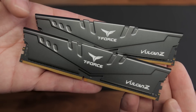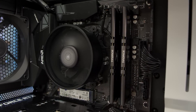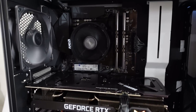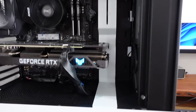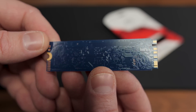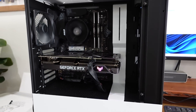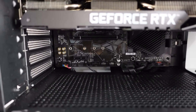We have 16 gig Team T-Force DDR4 — pretty sure it's a 3600 kit — good kit, but also potential for upgrades, you could swap it out for 32 gigs. We also have two case fans: an intake in the front and an exhaust in the back, which is all you really need, though you could add more fans or RGB lighting. Storage is a Kingston NV2 1TB NVMe SSD, totally adequate for now, but you've got an open NVMe slot at the bottom and room for SATA SSDs too. Since this is a full-size ATX build, there are expansion slots down here as well — so once Ian decides to start a streaming career, you can add a video capture card or something along those lines.